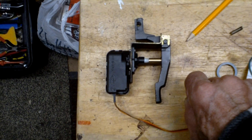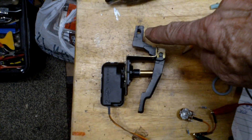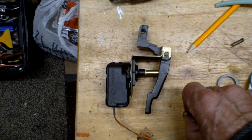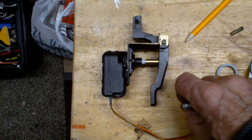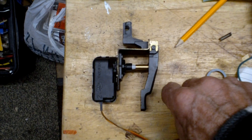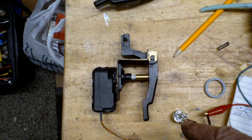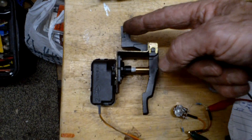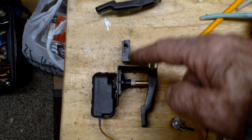Here we go — that's one extreme. This is the part that's connected to the headlight and actually moves the innards to change the actual beam. The beauty about this is it's going to be stopped anywhere — as you can see, this is infinitely variable. It's a proportional system basically, so it doesn't matter where you put the pot, it will follow it and go to it.